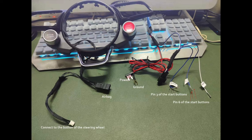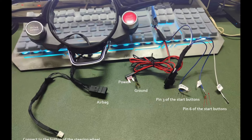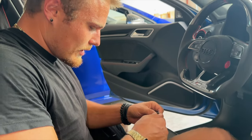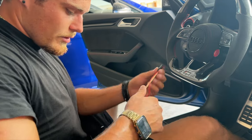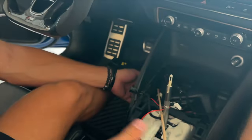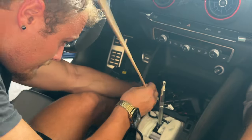Here's a photo to help clarify: looking at the wiring harness, the red wire is power, black is ground, and then we have a black clip and three wires with pins. We only need two wires with pins — use the two colored ones and ignore the white one. The black clip is also where we'll put the pins we pull from the factory harness. I'm going to route the red wire all the way to the fuse box using a little skewer to push it through the floor.